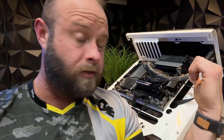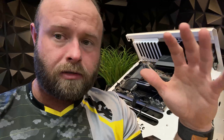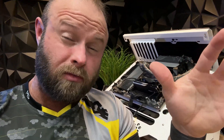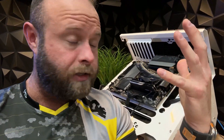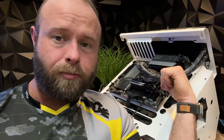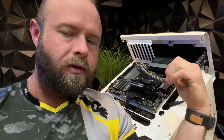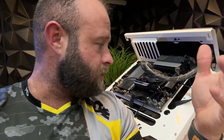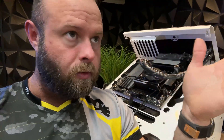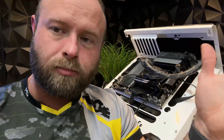What I'm going to do is return this board and swap it out for an Asus — seems like a little better quality, maybe more reliable. Hoping it's a hardware issue and not some sort of configuration thing. I had the DIMMs in A1 and A2 — I know I had them in the correct slots, but forums suggested I move them around into different configurations: one stick, two stick, A2, B2, and so on. None of it seemed to work. Nothing was happening.